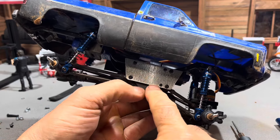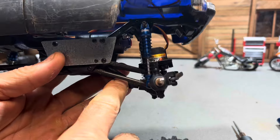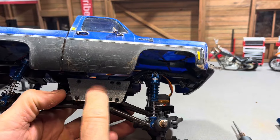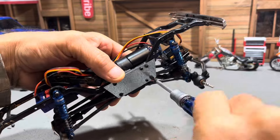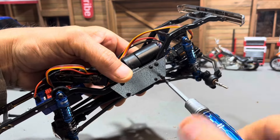To remedy all of that I'm making a transmission mount — this is real similar to an actual mud truck transfer case mount. I'm going to cut this out, attach it to the chassis rail, and then attach the transmission down here. That's going to allow me to make it even taller while straightening out the driveline and the four-link. I've got my mounting bracket made, going to make another one and get it mocked up. I fabricated the plate and brought the transmission transfer case down — it looked pretty good with the tire about right there.